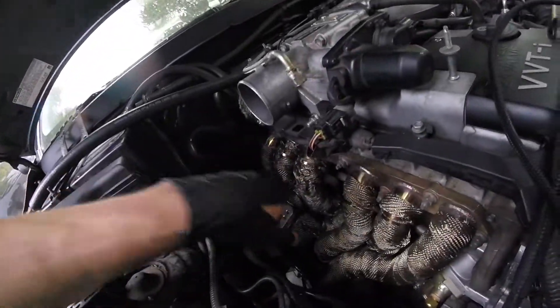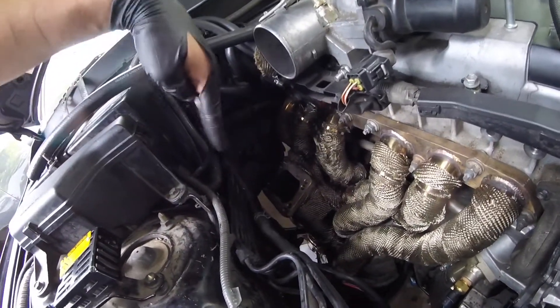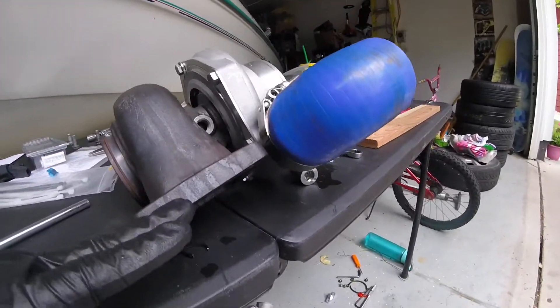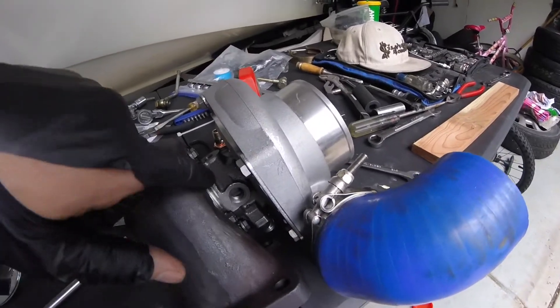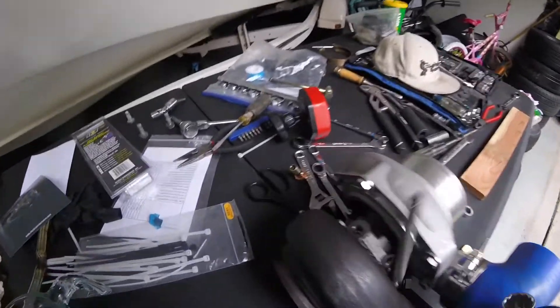I wanted to take a moment and talk about some of the quirks of the CX Racing Turbo as well as how I clocked it to fit on this manifold so that not only my turbo drain line can go as straight as possible down, but that I clear this runner and that I can also get to my coolant line as well as everything else - being able to access the bolts for the flange. So what I did was I clocked the turbo so that the flange and the inlet aren't quite parallel, but I'm slightly over midsection. First thing I had to do is mill the side of the exhaust housing down so that I could actually fit this coolant line on there and get a socket on it.